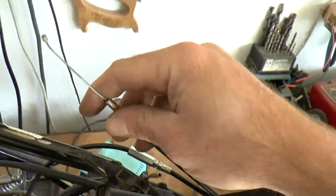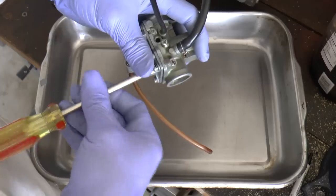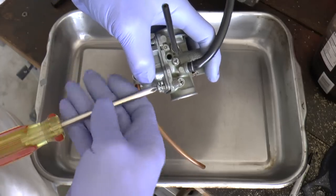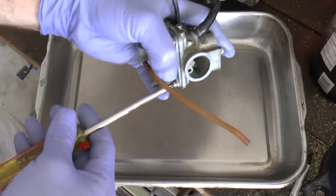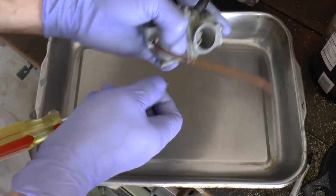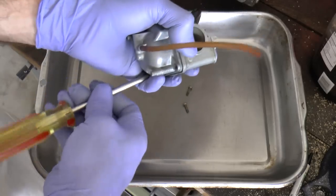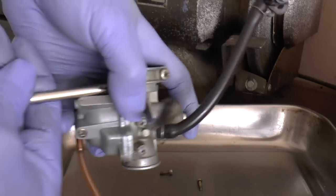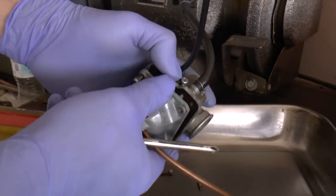When I turn this, the pulley on the oil pump moves, but that's only half the story here. This needs to be connected to the carburetor. Let's go clean the carburetor. I'm hoping this won't be too bad inside. The engine ran — the only negative effect was an overflowing carburetor, which usually can be traced to a little bit of trash in the needle valve. And if all I have to do is clean that up, I'll feel like I got off lucky. So let's crack this thing open.